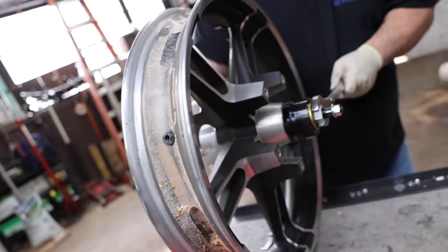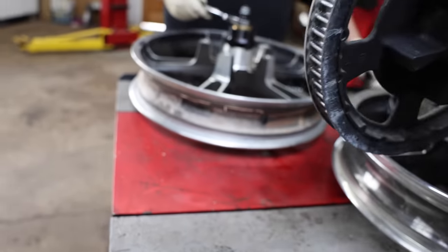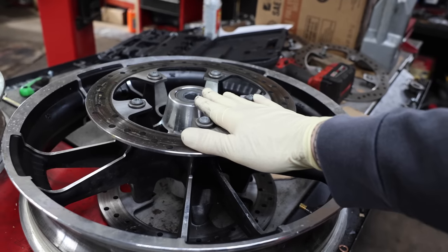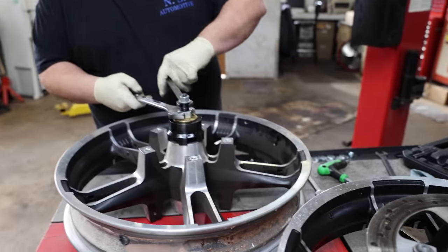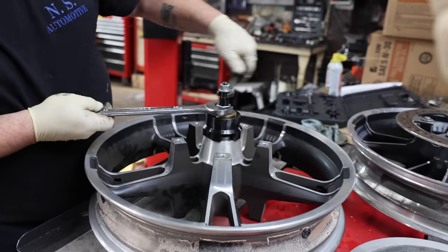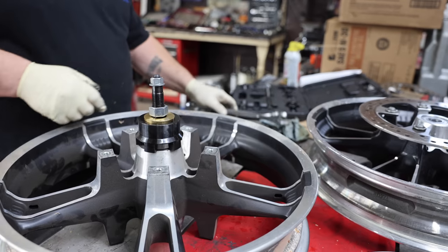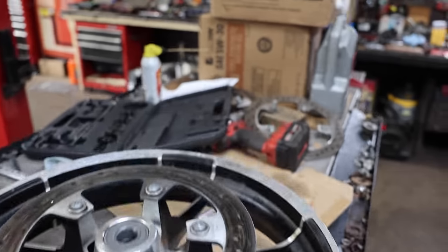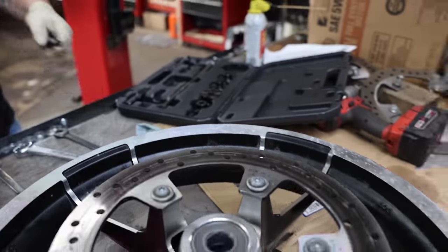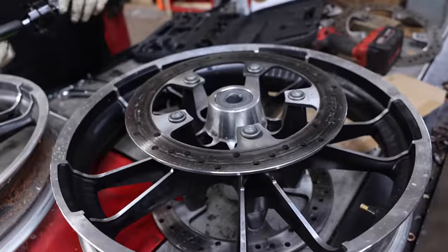We're going to take the rotors off. Nick's pulling out his bearing now — he's going to get that wheel powder coated. I'm going to get the pulley powder coated as well, because look at that: it only has 3,000 miles on it but it looks like it's been through the wringer. We've got to pull this bearing out too. Nick's got a really nice tool kit — we'll show you guys how that's used, because it's really important so you don't damage the bearing. The tool grabs it from the inside; there's a lip on the edge that expands and pulls it out. It's made by Pit Posse — really nice tool.